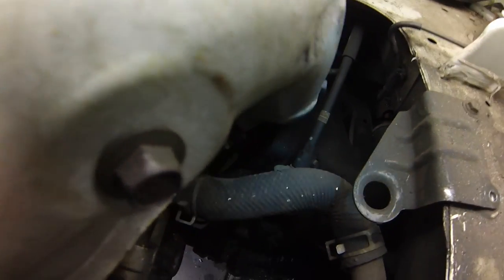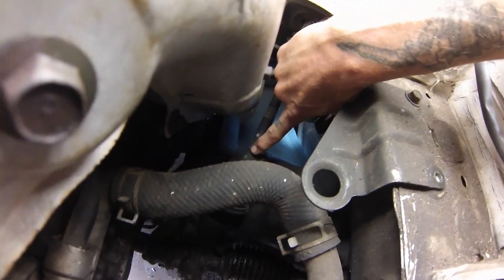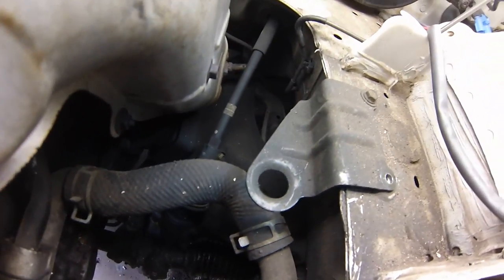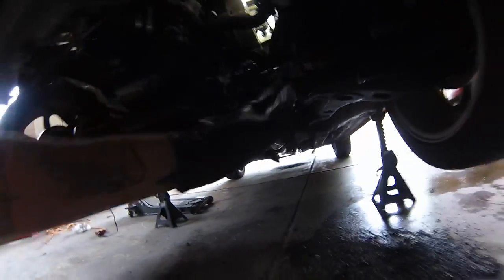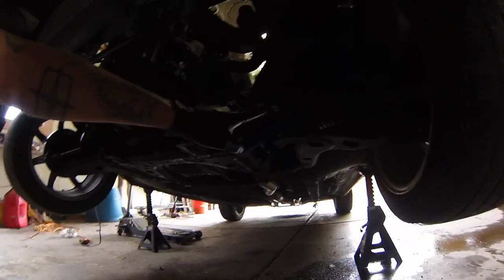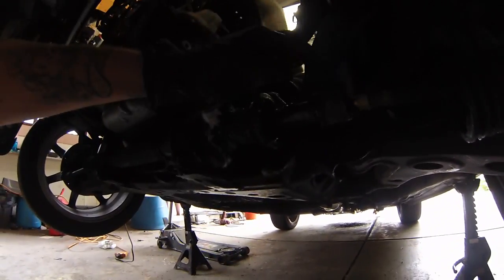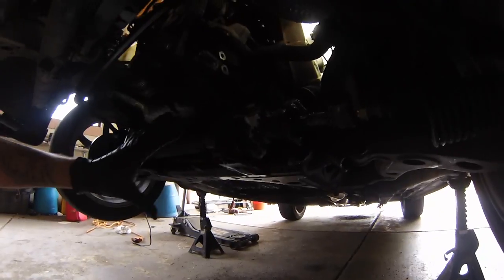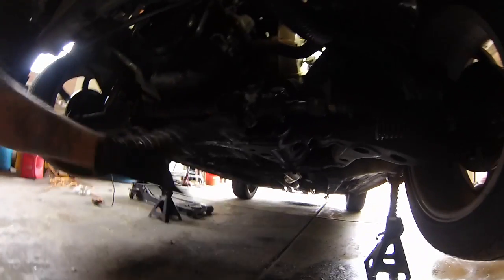On the steering linkage where the steering shaft meets the actual steering assembly there are two dots and also this tabbed mark that I marked onto the sleeve so I can arrange it back to the right way. It looks like that individual sleeve is going to only line up one way, which is an advantage for getting it back together properly. I've got one of the boots removed — as you can see it's split, which is really bad because the grease can't stay on there and dirt and debris can get in and ruin your inner tie rods sooner than you'd hope. It's like a ball so it spins — this right here is independent of this. There's a little tabbed washer we need to move back out of the way so this can spin freely. It's a lot easier to get this off and then let it drop down, and it won't affect your steering alignment.